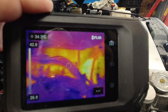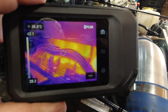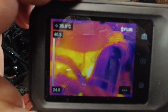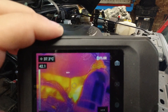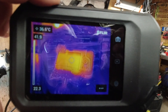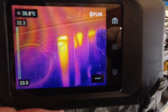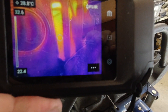If you're having issues with heating up — for example, if one cylinder is running hotter than another — this thermal camera would be able to pick it up and show you that something's wrong in that section. A lot of people have issues with their radiators too. If you had a blockage for whatever reason, you'd be able to put the thermal imaging camera on the radiator and see the heat. I can see my radiator right there where it's all yellow, and if you had a blockage, you'd be able to tell.